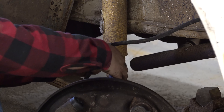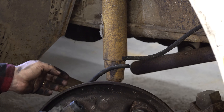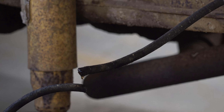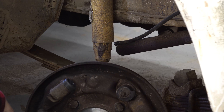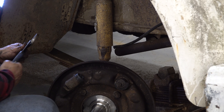Since I've already got brand new brake lines I'm just going to cut these off to save time. My biggest problem right now is I've got to get these wheel cylinders off. That's how we were bleeding it today — it's still got good looking fluid coming out. These wheel cylinders are odd, so I need to find them, take them off and get the numbers off so I can get the right ones.